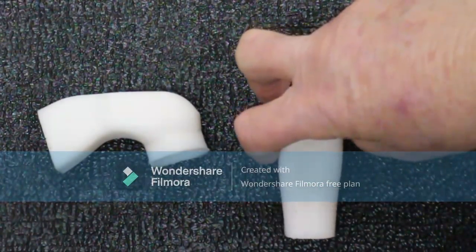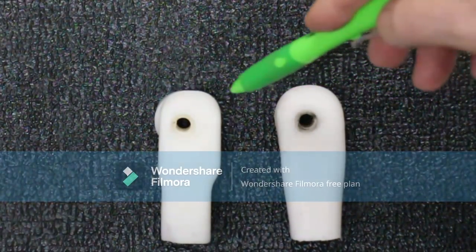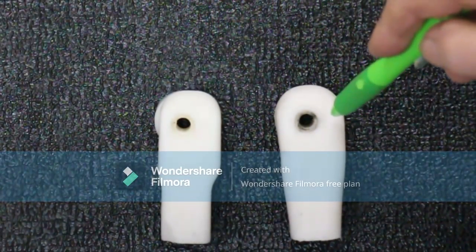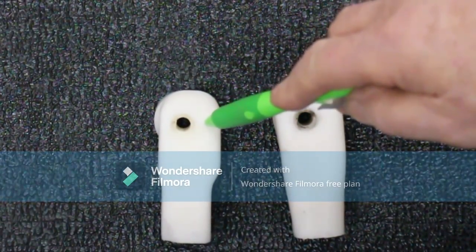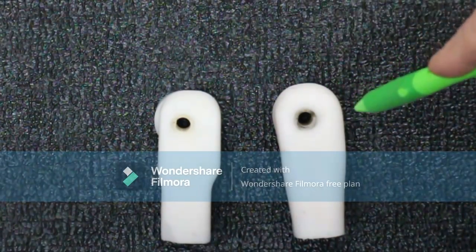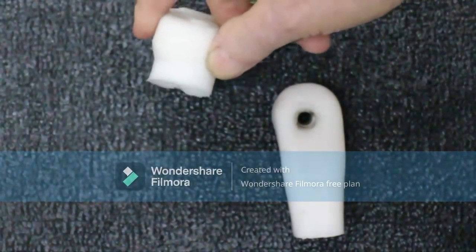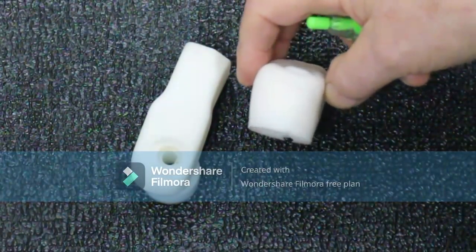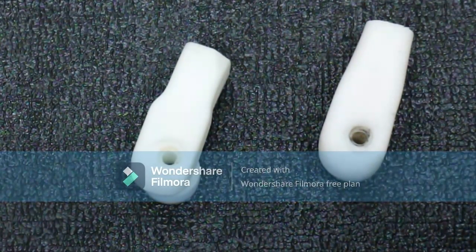So there's not a lot of metal to come out of the exhausts. The other factor I need to point out is this is the cylinder centre here, and the gases come out and they flow predominantly on the cylinder wall side. You'll notice the factory guys put a bigger clearance between the guide and the wall here for just that reason. And I've maintained that — actually increased it slightly. We'll probably see that if we look at the port end on. Take a look at that — you'll see that this bulges out quite a bit more. That's the principle upon which the ports were cut. Let's see how that functions in real life.